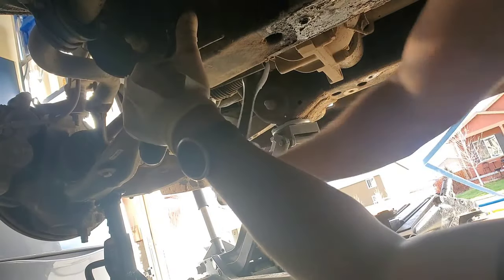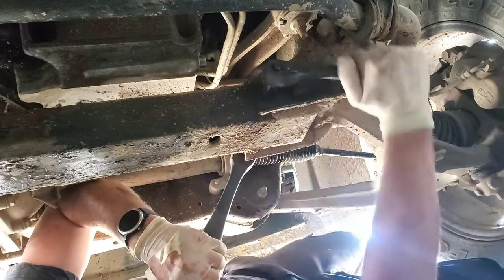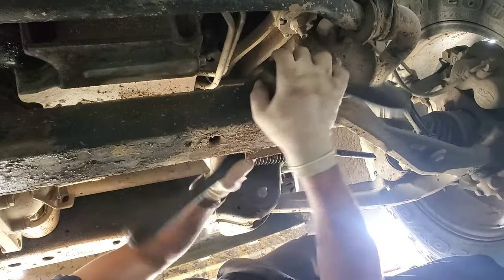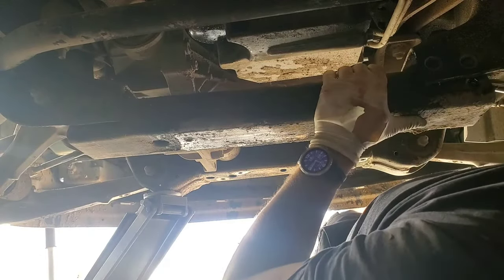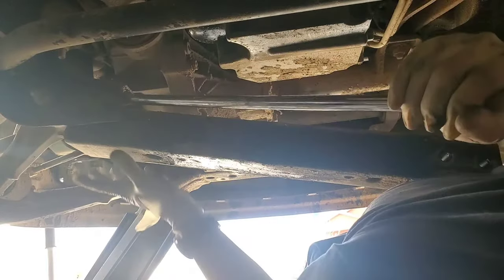The cross member is in the way of the oil pan and we're going to use that oil pan to support the old piston pumper. A couple of bolts on each side — this is the driver's side here. I like to use the double ratchet, although I drop it sometimes like an amateur. Maybe I am an amateur. Here's the passenger side — two bolts there, same kind of deal, just take those out. Once you've got both of them out, two on each side, four total, get your pry bar in there. I use the back end of a breaker bar. These things are really in there, so you're going to have to pry this cross member out.